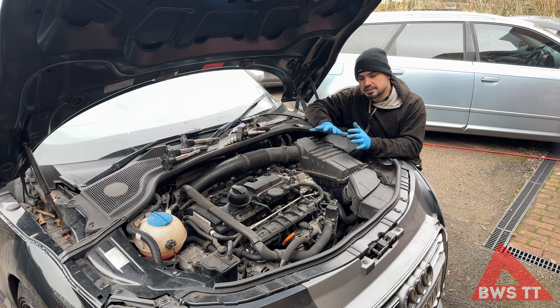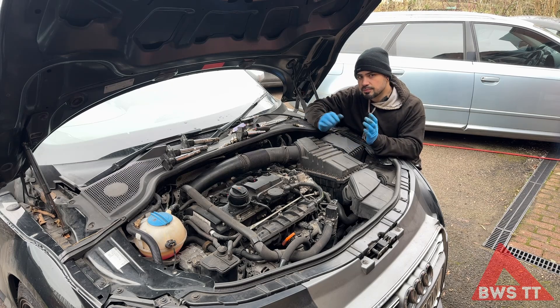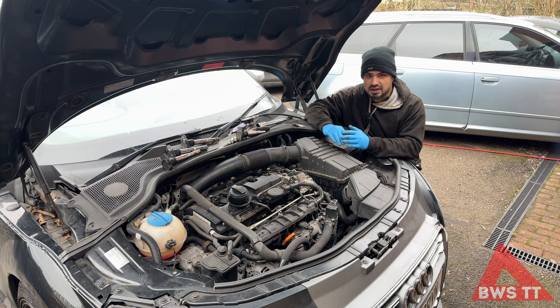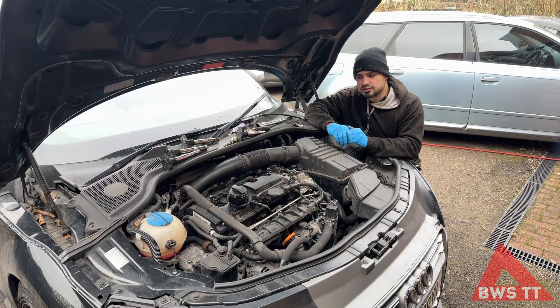What that does mean is that when it comes to my approach to tuning this engine, I'm not going to be trying to push this for its absolute best. You can get close to 400 horsepower out of these on the standard turbo with all the hardware modifications done to accompany that. If you go with an anti-surge core and then a hybrid, you can be pushing 430 brake horsepower on these engines without having to do anything to the internals. But with me having less compression and an older worn out engine, I don't think it's wise to take that approach to the tuning.